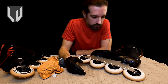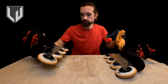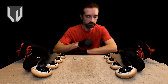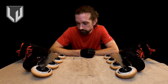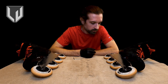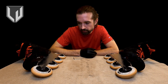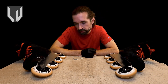A few more things to cover. Thread locker sets in 10 minutes, but it fully sets after several hours. So you want to at least leave them set for 10 minutes before you use them; it's better if you can wait several hours. As long as you inspect the frame afterwards and find that the axle screws aren't moving from their set positions, you're probably good to go.